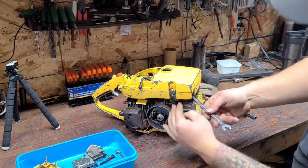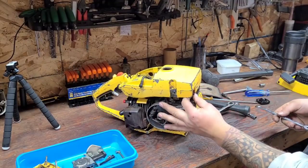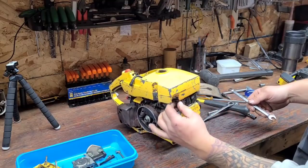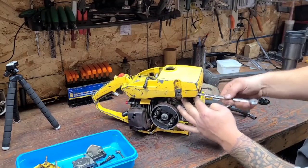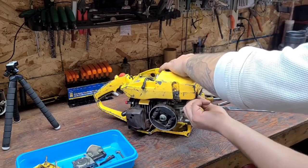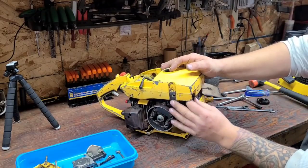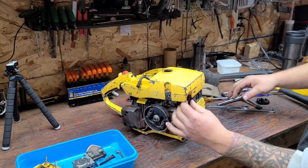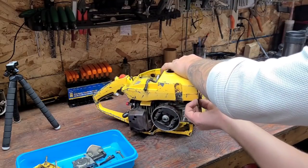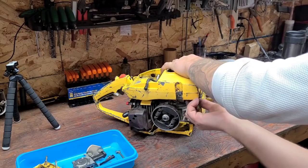I ground this wrench down almost 20 years ago working on a buddy's Shovelhead — we were trying to put the nuts that hold the cylinders down on an S&S Super Sidewinder 93-cube stroker. Those cylinders, the recesses in them, were a little tight for the nut. Being older and wiser now, I would have just taken my Dremel and ground the recesses a little bigger so you could put a socket in there. But being a younger man, just grind the wrench down. I've had that wrench for 20 years and it hasn't broken.